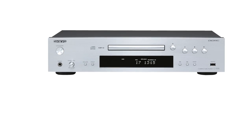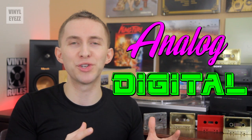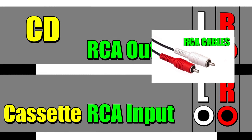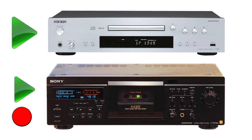The second way to make a mixtape is by connecting a CD player to your cassette deck, which allows you to put digital music on your cassette mixtape — blending both analog and digital together, which is pretty cool. All you have to do is connect the CD player's RCA out cables into the cassette deck's RCA input. Then queue up the tracks on the CD player, hit play, and on the cassette deck press play and record to make your mixtape.